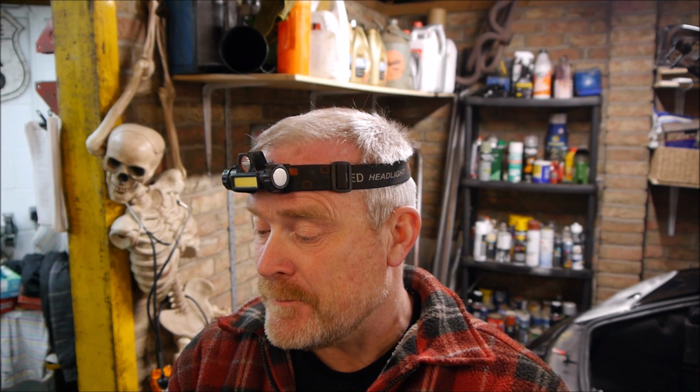Now they've got a backing pad on as well to reduce squeal, and they've got like an abrasive breaking-in compound on the top. And I like this because normal pads don't have this, and if you've got any undulations or anything, it'll just take several hundred miles to bed in, where this is quite an abrasive top coat which will really dig in to that disc and get it true to the face of this. And I've found that the braking efficiency is phenomenal. It just absolutely transformed the brakes of the Boxster. I didn't do anything else. Before, you'd drive it spirited, you'd brake and you'd be like, whoa, a little bit worried about this. Even a little bit of wee came out on one occasion. So upgrade to these. They're not cheap, but they are worth it.